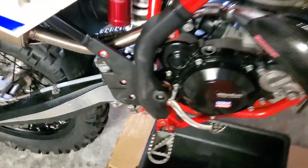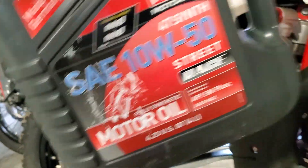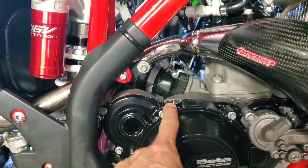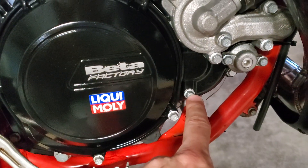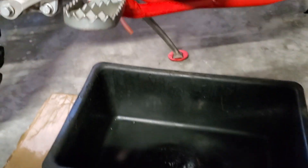One more quick review: 0.85 liters of the 1050. The fill hole — I took out the cap. The drain plug is down behind the brake lever. And the inspection plug, which I'll pull out later. So I'm going to drain it right now and go from there.